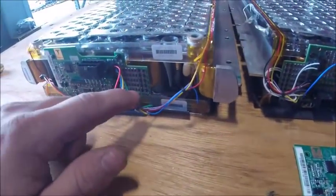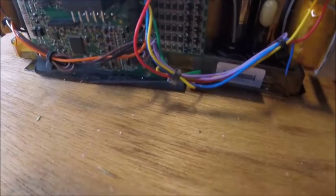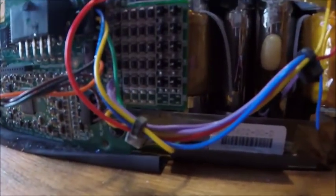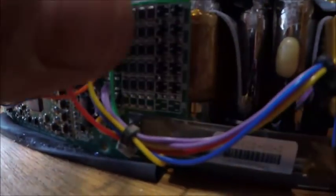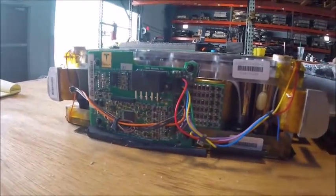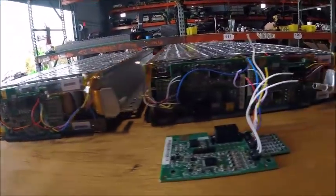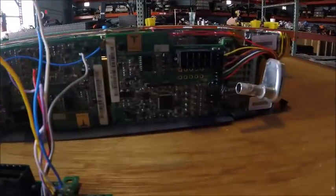Now the interesting thing is that the smaller pack has 5 rows of balance resistors, and there's actually 1 row of missing resistors right here. So there's 1 row that's missing everything because, again, there is 1 less cell per BMS, seeing how this one has 2 BMS packs.